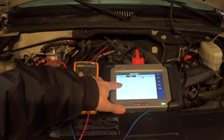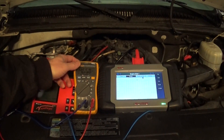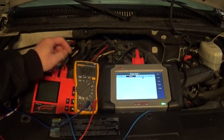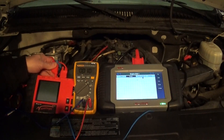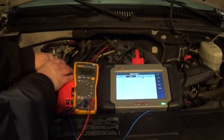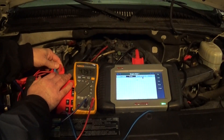Right now we can see the voltage is the same on my scan tool and my voltmeter. I know what my base voltage is — I can see there's about a 100-millivolt drop once I connect. It goes from about 4.79 to 4.8, then down to about 4.6 — a very slight voltage drop, but that's okay.